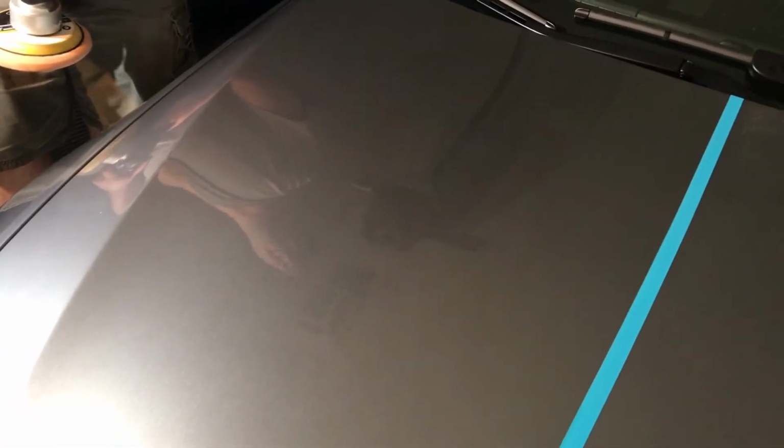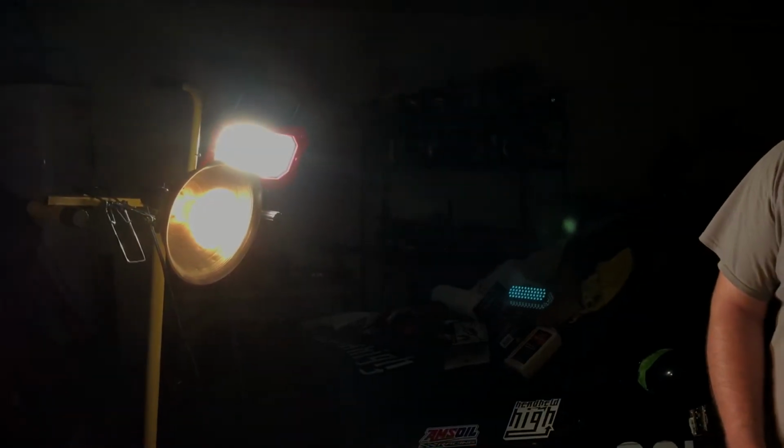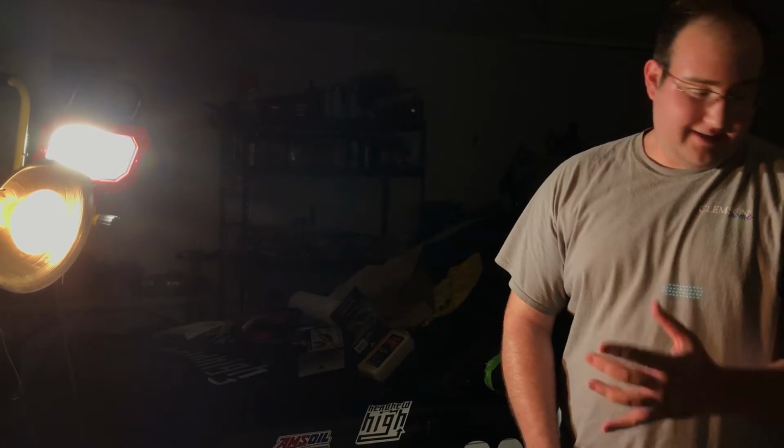The Snap-on light's an LED, which is more of a fluorescent, and when you have a fluorescent shining on a paint surface, you can see swirls and minor scratches and imperfections a lot easier. With a normal light, it's more of a natural light, as if it's outside, and that yellow hue can really show water spots and stuff in the paint. I could see that there was tree sap stuck on the paint with the yellow one shining on it over this one. It looks kind of weird, but there is reason to it. Different light just makes sure you can see everything.